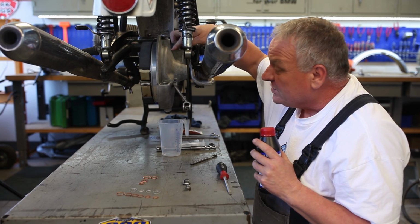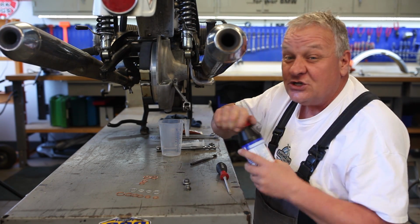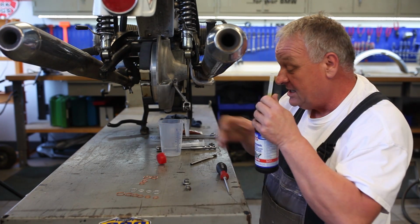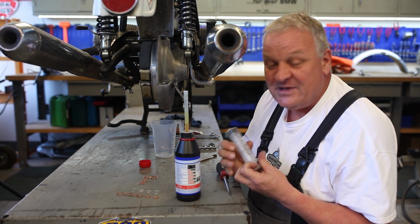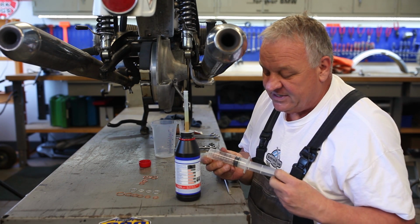Now the swing arm oil takes 150 cc's. On a short wheelbase, 100 cc's, because it's shorter. A couple ways you can do this. We offer these pretty cool syringes. We have them in 60 and 50 milliliters, so you could pour oil in here 3 times 50.